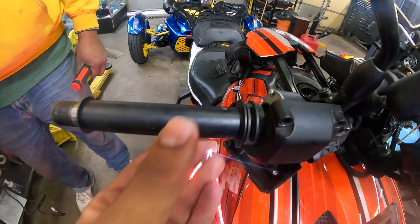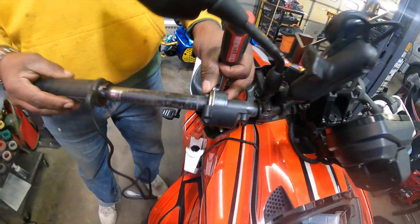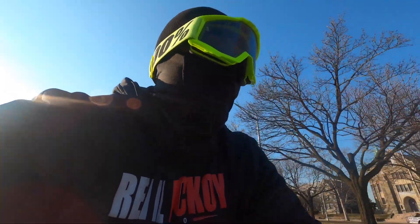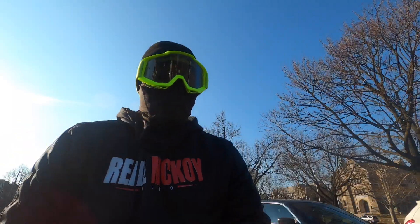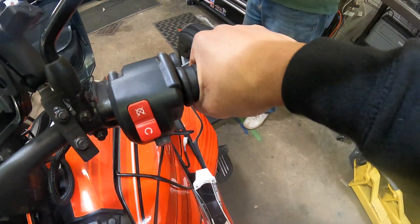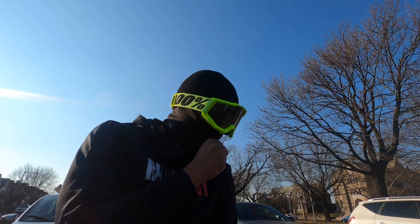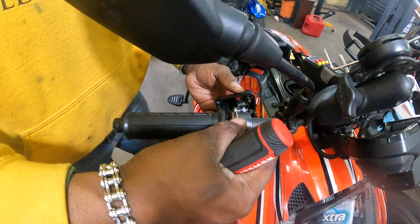Go to the clutch side and take the piece of sandpaper and clean off any glue or rubber left from the old grips. Test the grips. Mark the location of the grips with two pieces of masking tape by placing one of the new grips on one side of the handlebars so when you slide it back on, you can stop it in the same position.